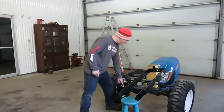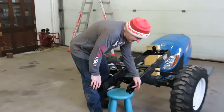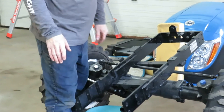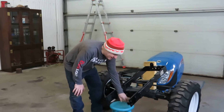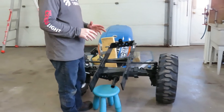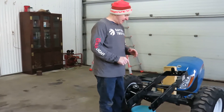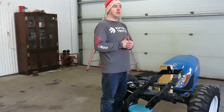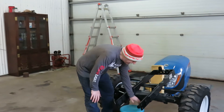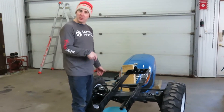Here's the front differential and the frame segment. What I need to do is install the six bolts per side that thread into the engine block. I also have to install the driveshaft, which is over there. I'll slide the driveshaft underneath the engine and let it protrude up front, and there's a driveshaft cover protector that will match up with it. That's what I'll start with first.